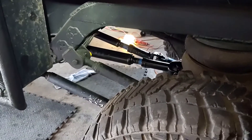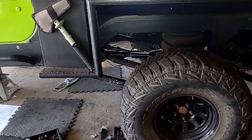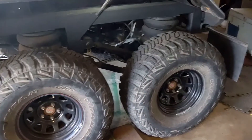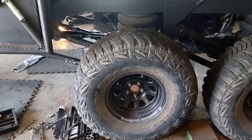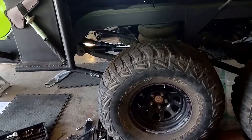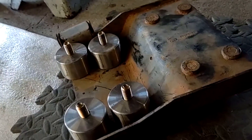Now that I have longer shafts, I should be able to get more articulation over to this middle axle. The problem before with the dual transfer case setup was a very short shaft in the middle — only 13 inches long — so I had to put a limiting strap on this axle. These airbags will drop over 20 inches, and total compression and travel is almost 26 inches. Now we should be able to get more articulation than before.